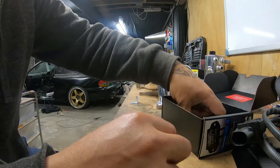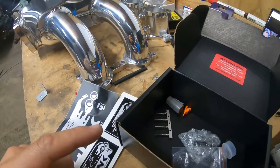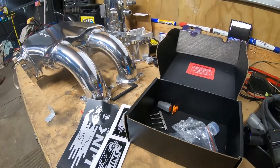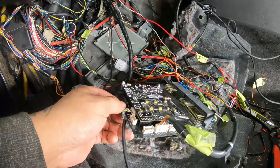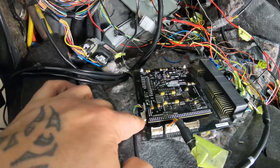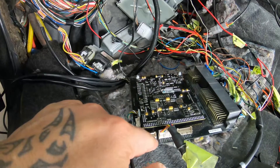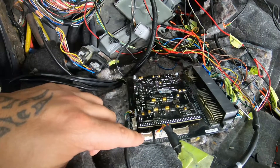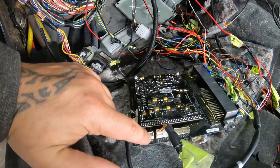There's that part, and the only thing left is the plugs and pins. We were going to wire it separately but we're not going to use those, because on my ECU - actually let's go take a quick look. So on my ECU, this is still the plug-in. I've got a couple of white plugs here - this one is CAN 1 and that one is CAN 2. To hook up CAN Lambda I'm going to have to hook it up to one of these. I'll go with CAN 1, but I need this other white plug which the kit didn't come with.